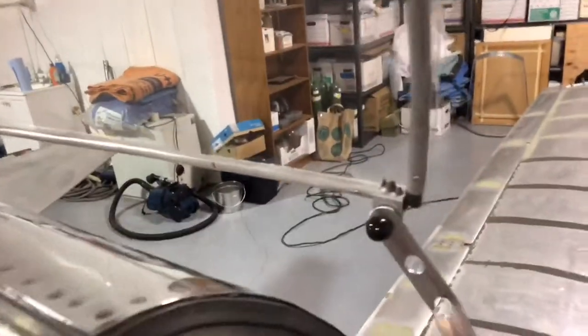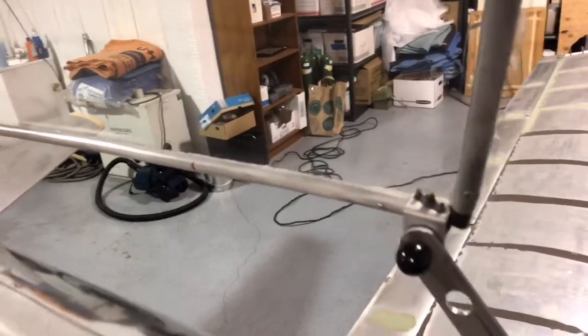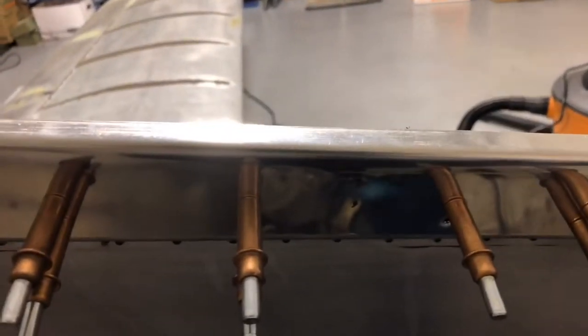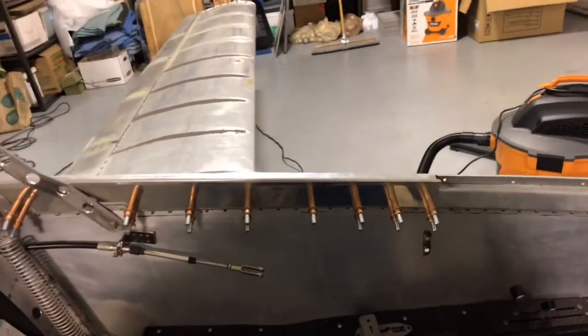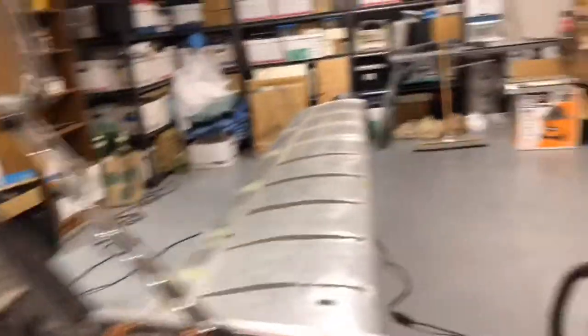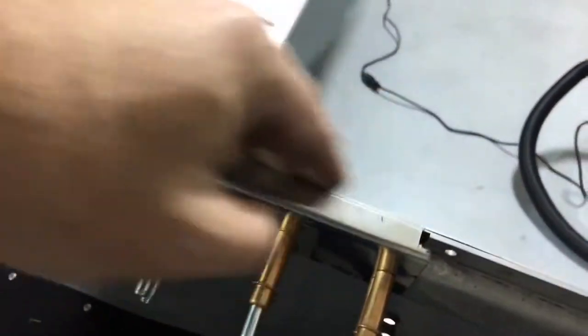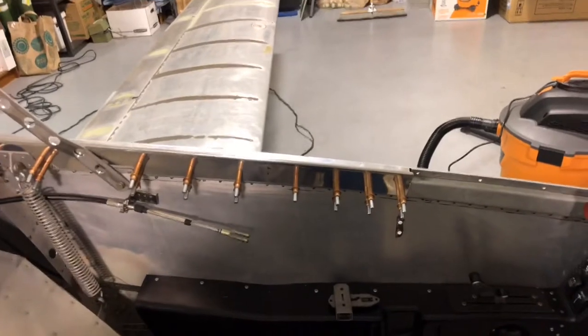So it looks like it's going to be aft, but I'm not going to drill any holes right now. I've made the mark in the canopy itself eight and a half inches back from the forward edge per instructions, and then I made the mark into those sills where that's going to align. Since I've got everything clicoed in, I've scribed the edges so I've got a smooth edge out to the outside edge.